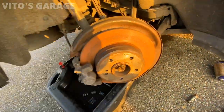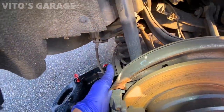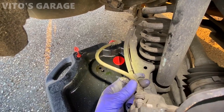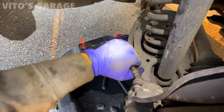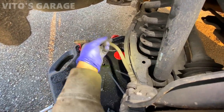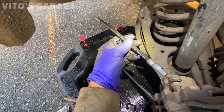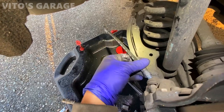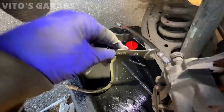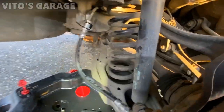I'm going to change the brake hose on this side. The reason why is there's a bunch of cracking starting on it - not safe, time to change it. Pretty sure it's original and never been changed. I first disconnected it from there and then from the caliper. Yeah, it definitely has stress cracking. Got the new one. I'm going to start installing the new one on the caliper first, and then tighten it and install it up top. There you guys have it - fresh brake hose.